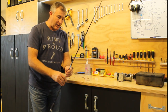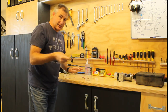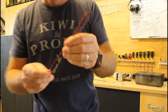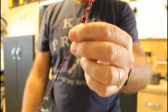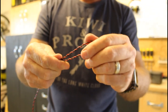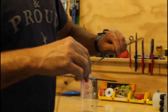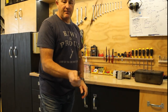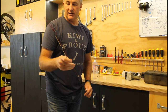What I found worked really well was I took a fishing rod — one of the two-piece ones — I took the end off it, and that gives me the reach I needed in the boot and the flexibility. The other part I used was some bell wire, two strands together with a loop in the end. Solid core is important so that you can bend it and it'll stay in the shape you want it. I feed it down the end of the fishing rod, which gives me the reach and a hook on the end so I can hook the C lock.